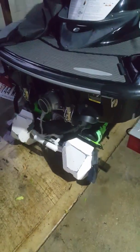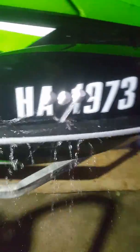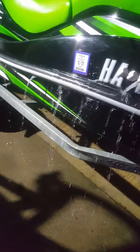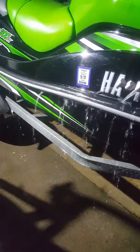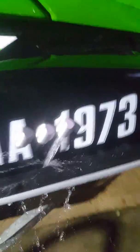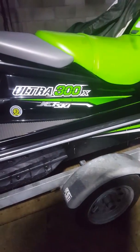I don't have to have the engine running. Come up the front and you're going to see the excess pressure coming out of your outlet — this is the intercooler side. You can see how much pressure is coming out; the water is pouring out probably more than the back end. So that's showing you that you're releasing over half the pressure that this engine's intercooler system would typically be having. Like I said, if you watch my earlier videos first you'll be able to understand this a little bit better than just starting from this video.